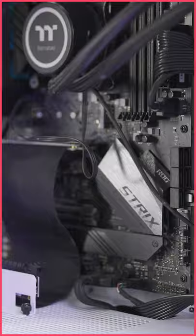So it's this simple. Basically all I needed to do was jump the two pins for the start button, or where you'd normally put the start button, and that way you'll jump start your PC once it's shorted the motherboard.